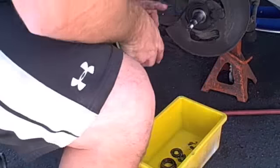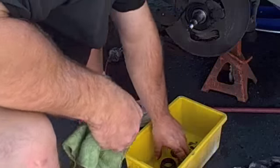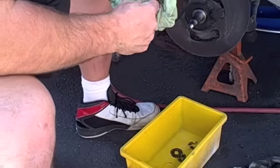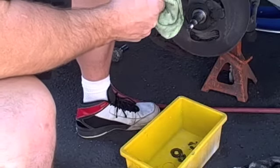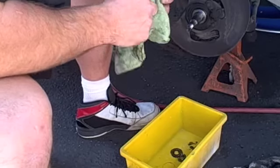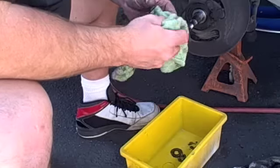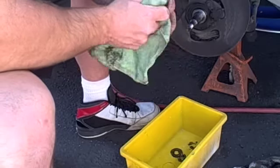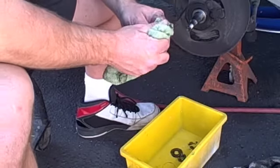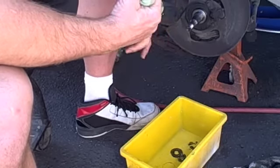Let me show you a little trick I learned when I was a kid. They make a machine nowadays that packs these bearings for you, but about 20 years ago when I was 12 or 13, I worked for a guy who ran a carpet cleaning business and he showed me how to pack bearings — even some dealerships do it this way. First, clean off all the old grease. You can soak these in gasoline, but I don't recommend it since gasoline is a bit abrasive.